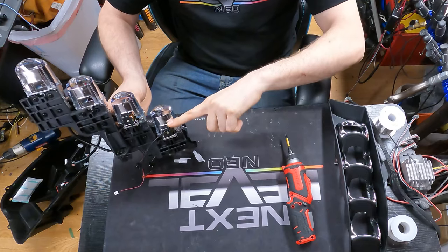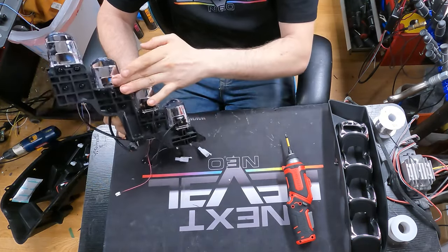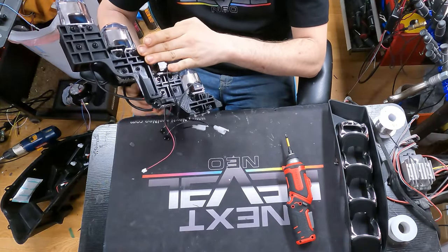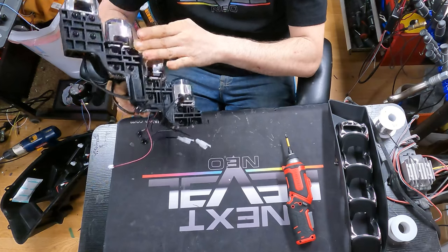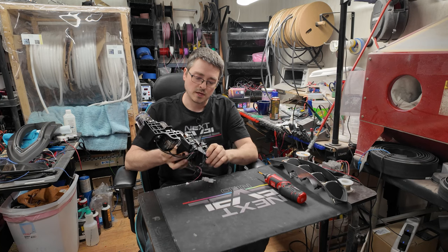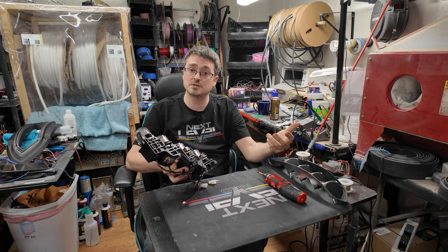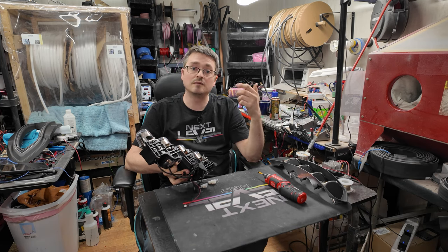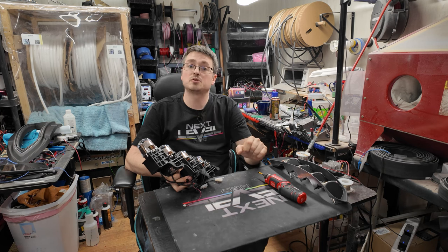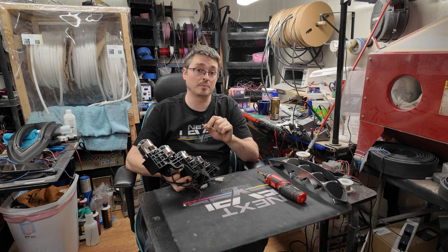That is what these little solenoids here are for. Those are for flappers. And these would be a dedicated high beam from what it looks like. I don't see any kind of a cutoff shield or anything in there. So dedicated high beams, and these would be the high and low projector outputs. So just something to keep in mind if you are quoting this for somebody or if you're building it yourself. As for the feasibility of etching lenses with Alpharex in general, I wouldn't even try it, because if you mess one of these lenses up, I don't even know the process to get a replacement.